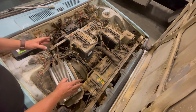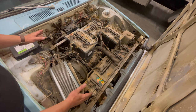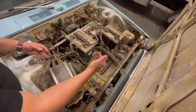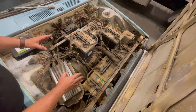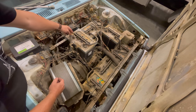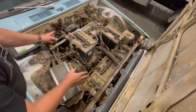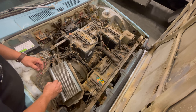This gets me thinking of an idea — what if I didn't even replace these batteries to test this? What if I just hooked up all the jump packs I can find? The jump packs are 12 volts, so they're going to build voltage much quicker than the 6-volt batteries. I might have enough voltage just in jump packs to test this. I can hook the positive lead of a jump pack here, chain them all together, and then hook the negative up here. Let's go grab those and see how many I can come up with — I'll also need one to run the rest of the car.